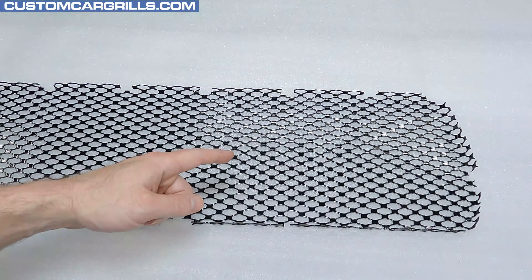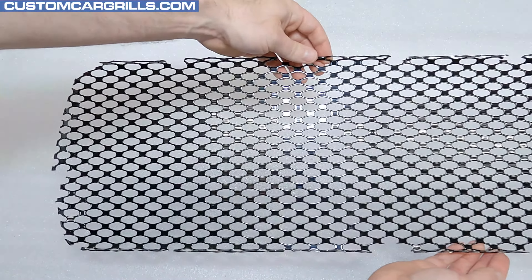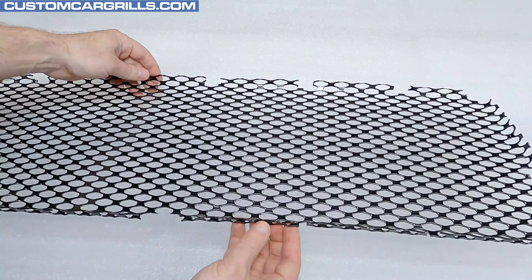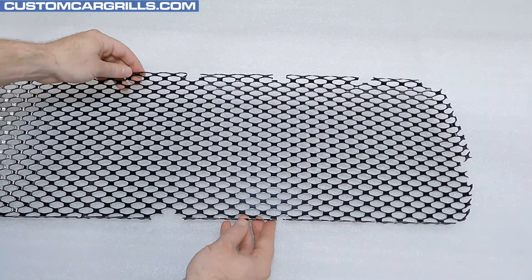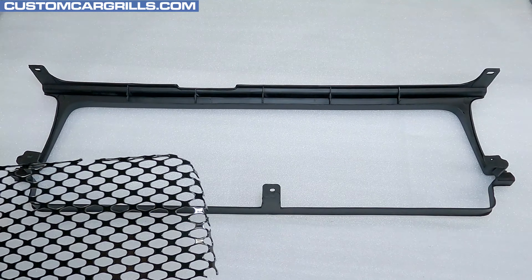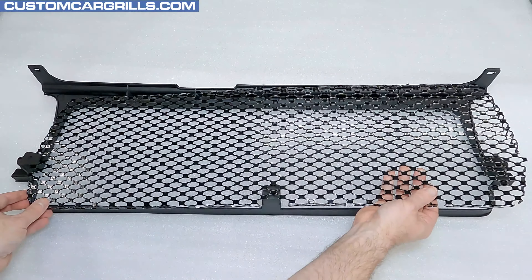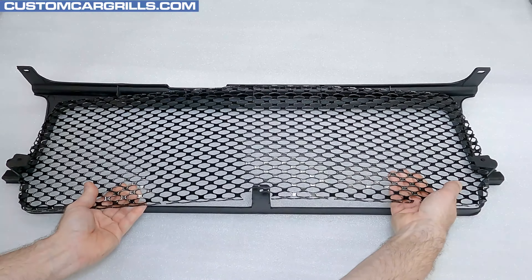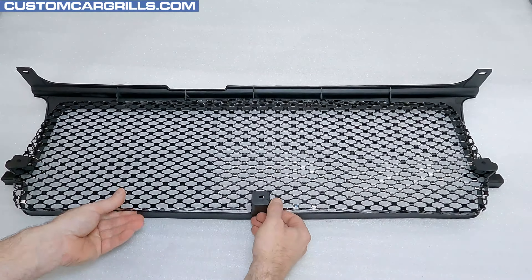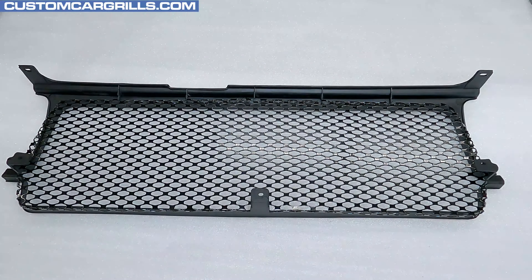Here's a look at the mesh piece that we have available on our website. This is pre-cut and pre-bent specifically for the 80 Series Toyota Land Cruisers. All of the right cuts and bends have been made in all of the right spots, and this mesh piece is ready to install right out of the box after your stock grille has been modified. There is a little bit of a trick to angling this into place. From the back of the grille and with the bent tabs on the mesh piece facing forward, slide one side into position and then flex the mesh to get the other side in. At this point, the mesh will be resting on the lower tab and that area can be gently pulled down to let the mesh pass forward.